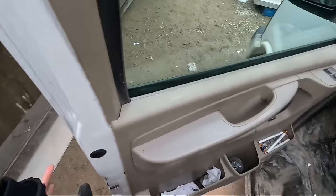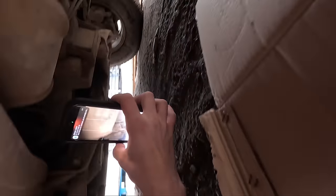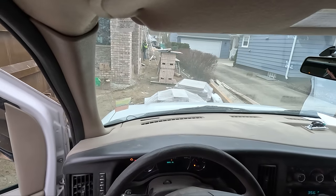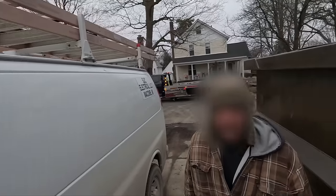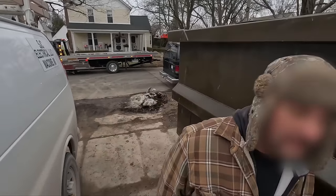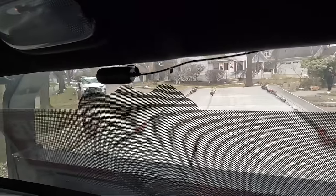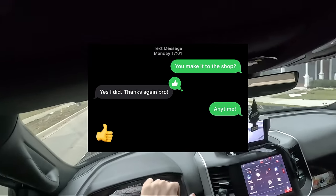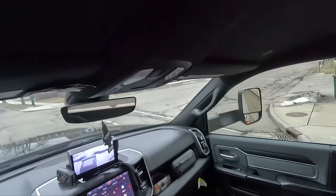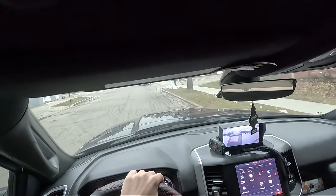If that happens again, let me take a video so I can show you and walk you right to it. Just shift it nice and smooth. The customer's name is Christian — same as mine! He's saved from paying for the tow; he just pays the service call fee and learns something extra. He's going to drive over to the mechanic so they can replace his transmission linkage — super common issue on most vehicles with a rubber plastic bushing.